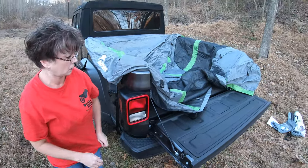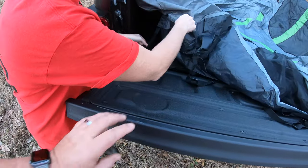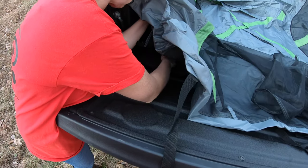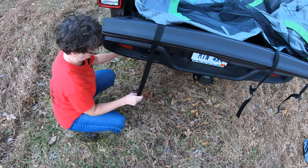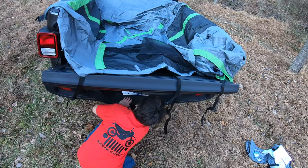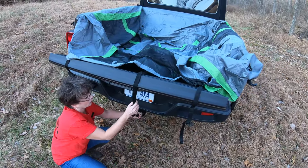Do the same on the other side. Now we're going to take this strap, raise the tailgate up a little bit so it'll go down through there, then put it down and behind the tailgate and behind the bumper. Pull the strap from the bottom and snap the two together like so — we'll do all three of them the same way. I've got my lovely wife helping me and that sure makes it handy.